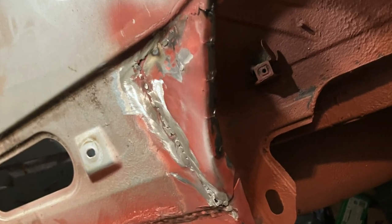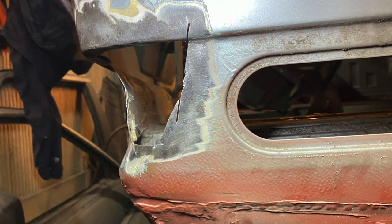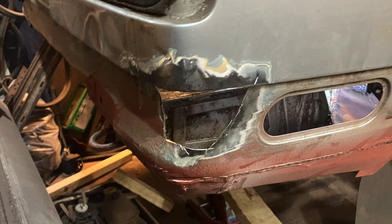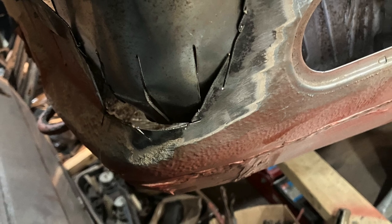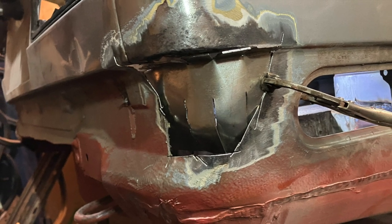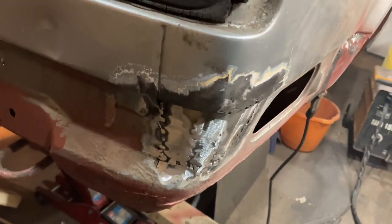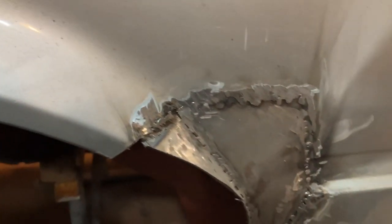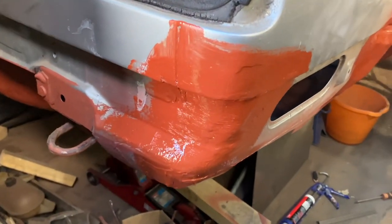That was another piece I didn't video fully. The section under the rear light was quite rotten — same again, I cut all the rust out and got back to good steel. It took a bit of head scratching to figure out what to do, so I got a piece of 1.3mm steel and put some slits in it to handle the compound curve — it's got a curve at the top and then tapers in as you go lower. I bent an angle at the top, and although it looks a million miles away at first, once you start tacking it on and knocking it with a hammer it's not too far off. I welded it in to give all the strength back, put a few more welds on, and finished off one I couldn't reach when the car was on its side.